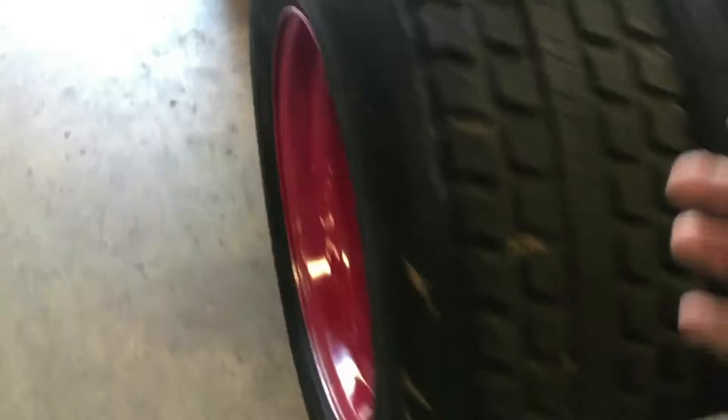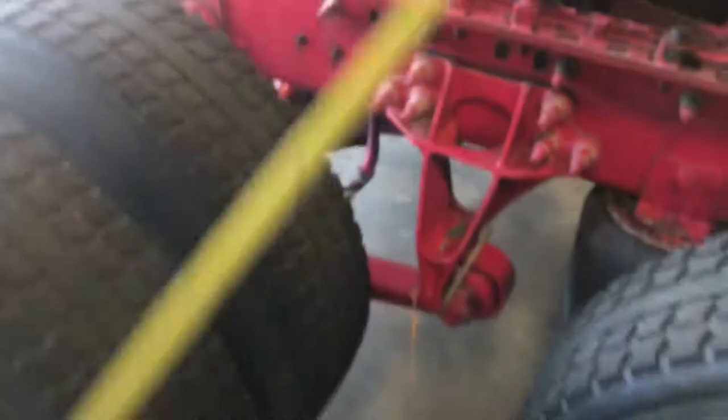I measured the entire height of the tire — about 40 inches — and made a center mark. I put my tape measure starting at that center mark, find a similar reference point on the angle iron, and take the measurement. I do the exact same thing on the other side, subtract those two numbers, and the difference is my thrust. I repeat this for the rear tires using that same piece of angle iron.